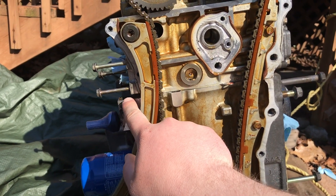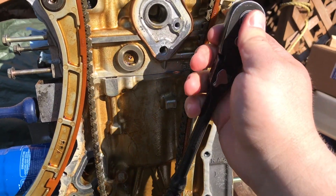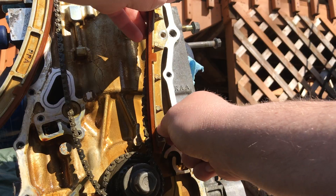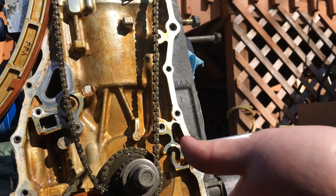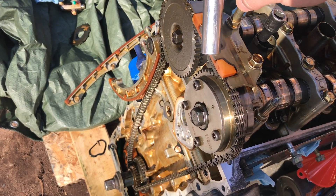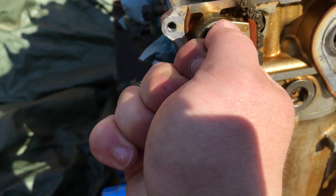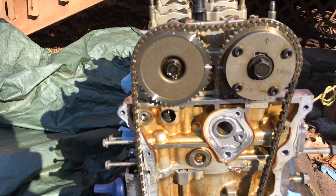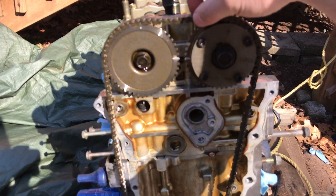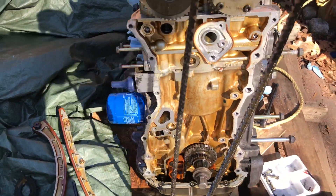It's just dangling. What I usually do is leave this guide hanging and remove the top one first, or this one right here — in this instance we'll just remove this one. These are all 10 millimeters as well. She's off. There are two 12 millimeters at the top for the top guide — go ahead and break those free and remove the top guide. Get yourself an Allen wrench to match up the hole. She's basically done. Remove it from the top — take your chain, lift up off of the VTC actuator, then lift up off of the exhaust cam, and simply right over the bottom.